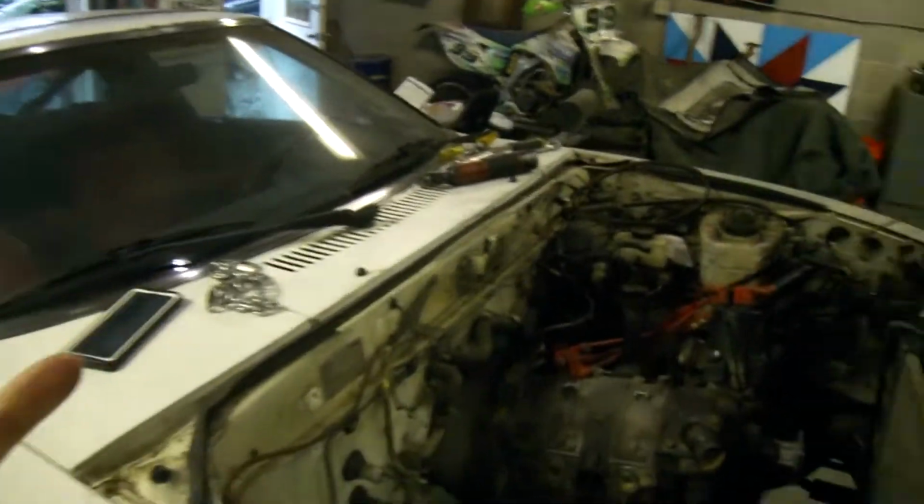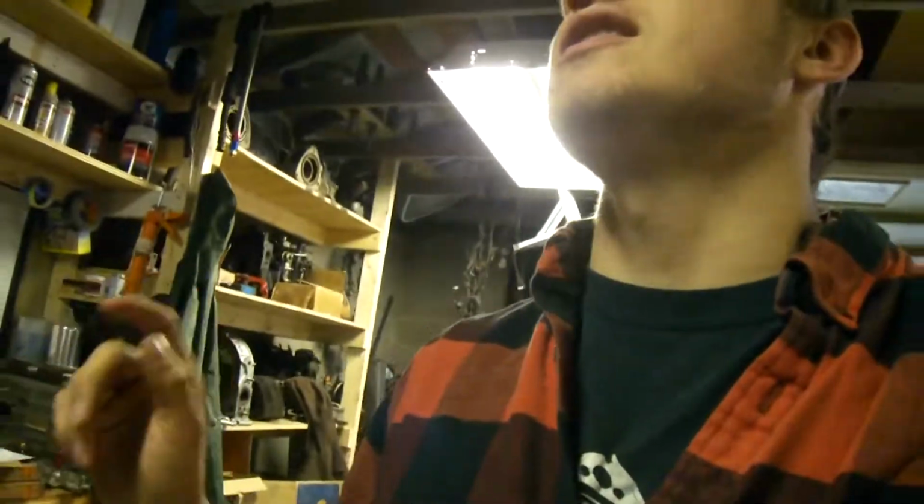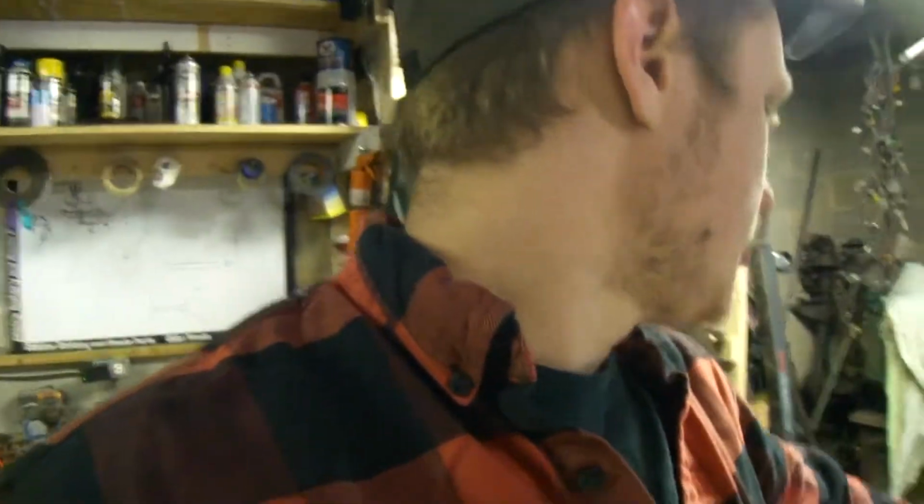So, things we need to do. Well, one, if I'm feeling ambitious tonight, which I might, but I really don't have a welding helmet here because Justin has my stuff. That's a Pacesetter header right there in the middle with the collector. You can pick one of those up off eBay or Summit Racing for, I don't know, 100 bucks. And because it's a 12A car, I can't use the GSLSE 13B manifold, so I have to refabricate and make a mid-pipe and hook that header up on this 12A, which is fine. So, I got to do that.